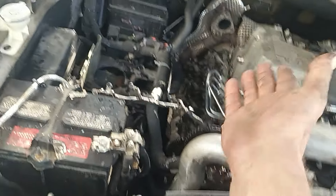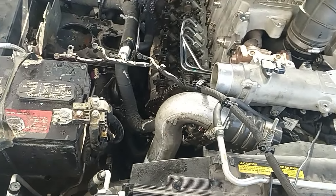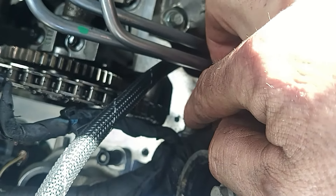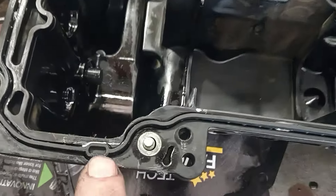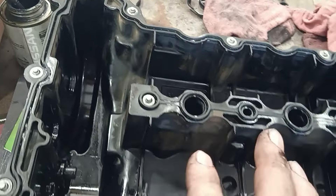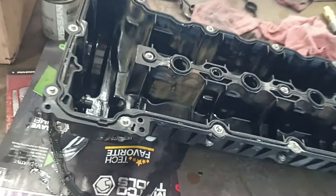I removed this bottle just to be able to get the wiring harness out of the way. When you put the valve cover seal on — where the timing cover meets, right there is a line, and on the other side there is a line. You're going to have to put RTV silicone on it — right here where the cover meets. Put RTV silicone in each of these spots and on the metal itself so that it seals. I put little dabs of RTV here and there on this, just to make sure it doesn't kick off while I'm putting it in.